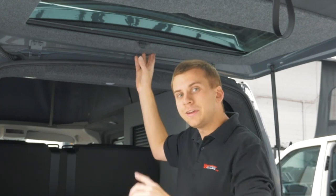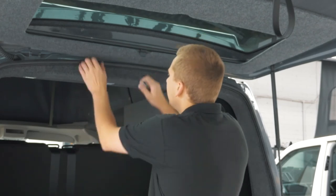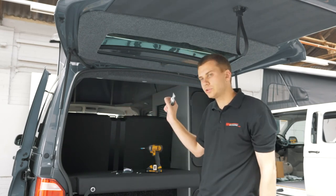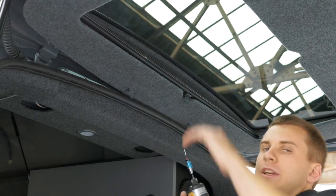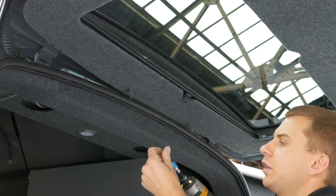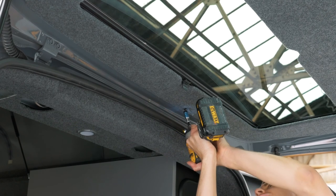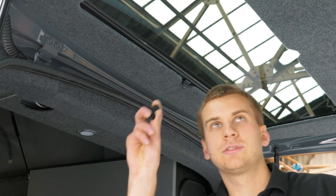First, in order to perform a blind fix in the face of the window pod, we're just going to make a small incision with a Stanley blade. So if we make a small triangular incision and then peel the carpet back, we can fix the two small screws for the face of the pod. The small self-tapping screws go through the face of the pod into the window recess of the vehicle. The steel behind here is on a slight angle, so just check behind there and make sure you're going to use a suitable angle for your drill and your screw. Then just fold the carpet back over and don't forget to put the screw cover caps on the tek screws at the bottom.